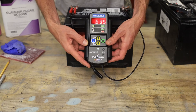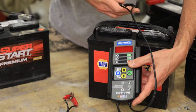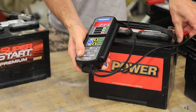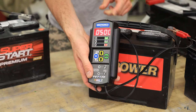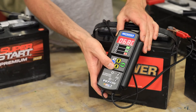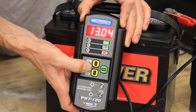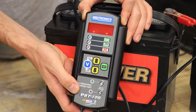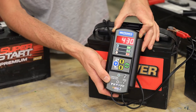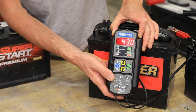It gives us 635 out of 650 — that's definitely a really good pass. Let's test another battery. The terminals are in a slightly different order on this one but we'll hook the tester up. It's a group 24 battery, fully charged, no CCA rating listed, so I'm going to assume at least 650. We hit test — we get a whopping 430 out of 650. That is not a good pass, and we can back these results up with the carbon pile — this one falls off pretty quick.